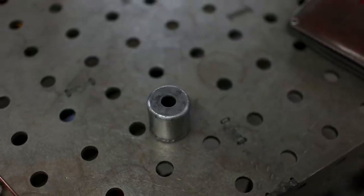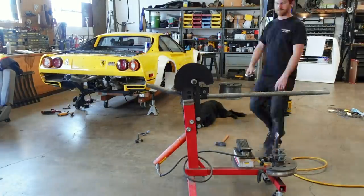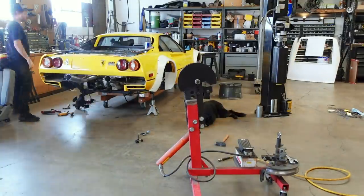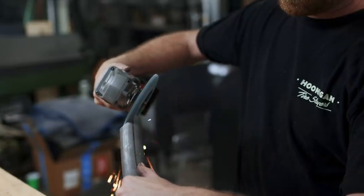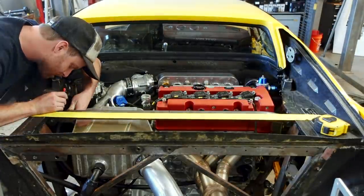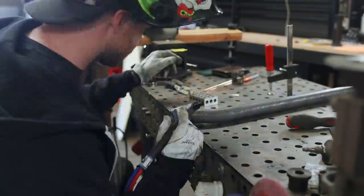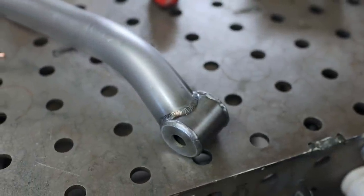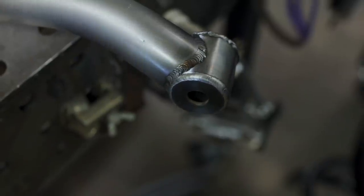The result is two pieces we can bolt into those original shock connections. I pulled out the tubing bender and got to work — the tube needs bends to jog around the K24's cylinder head, but with 30-degree bends and some proper copes we're in business. Getting the tube copes and length correct was a process of repetition to make sure everything in the engine bay was straight and square. I welded this up with 3/32 tungsten and 1/16 inch filler rod — the most comfortable I've been welding TIG so far.